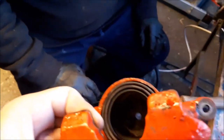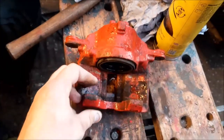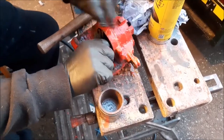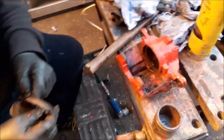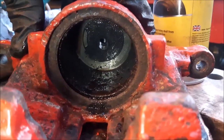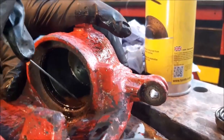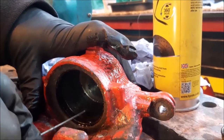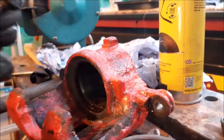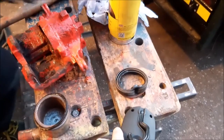If we look inside, that's where the piston was sitting, and you can see the old sealing there which we remove out, and we'll also be cleaning in there as well. There's the dust cover. That gives you a better look in there — it's in good condition but just dirty, and we'll obviously be cleaning all of that out. Now we're just getting the seal out. There is the seal — we're going to be changing that. It all comes in with the kit: the new rubber seal, the new piston, and the new dust seal.